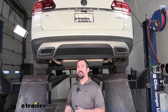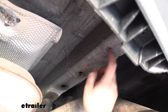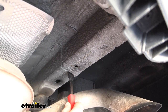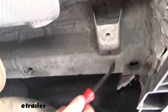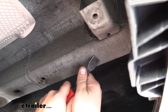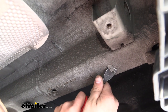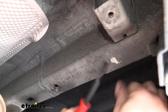To begin our installation we're going to need to scrape off some undercoating on the frame. You can see it's all coated on there — a putty knife works pretty well, I have a scraper here. Our hitch extends right at this seam, so I'm going to start here and work my way forward so the hitch has clearance and sits nice and flat. If we can get a nice opening here we can work away at the rest of it. This is going to be a little bit tedious so make sure you have a nice putty knife or something strong enough to get it all off.